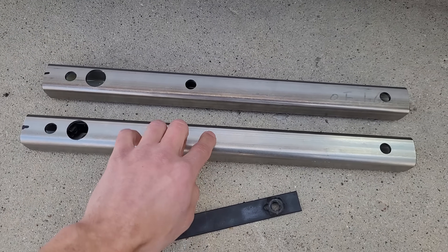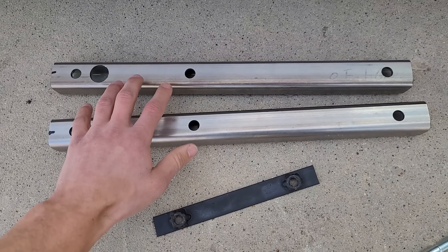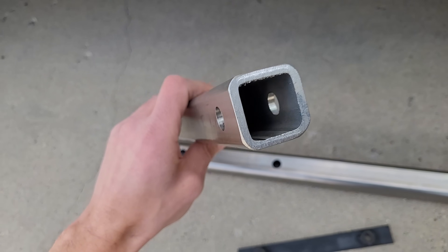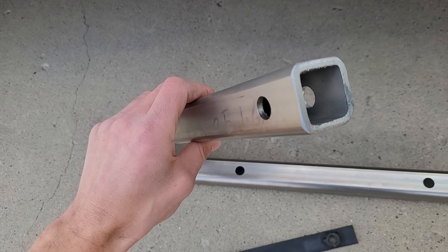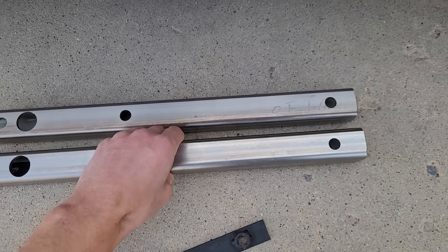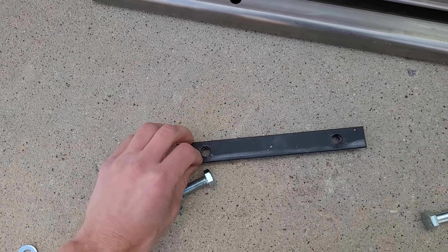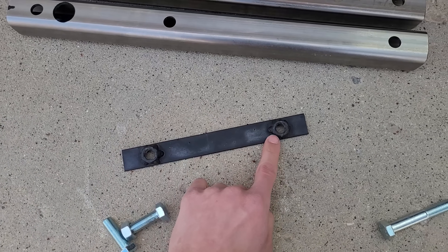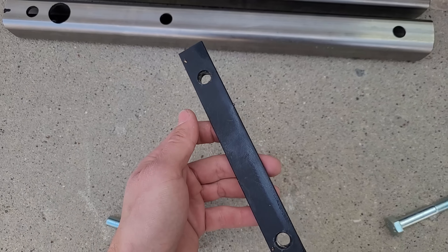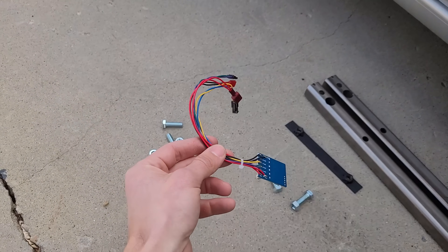The raw material was about $80–90 — I got stainless steel thick wall mainly because I didn't want to deal with painting or powder coating. Powder coating would be difficult to do on my own inside there, and having them coated at a shop is a two-week process. So I just paid more for the material, and since they're stainless they won't rust. These other parts were just basic steel that I welded nuts onto, and they were easy enough to paint all the way around.